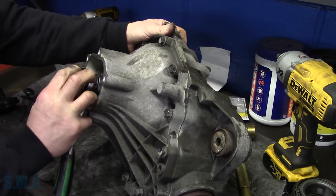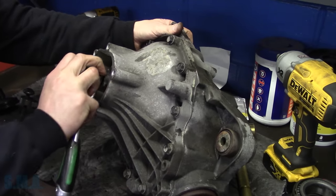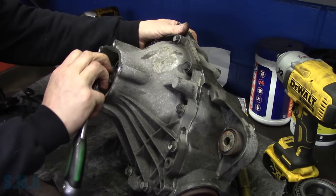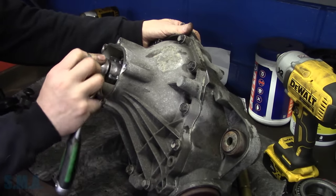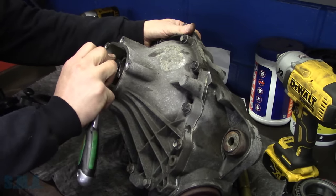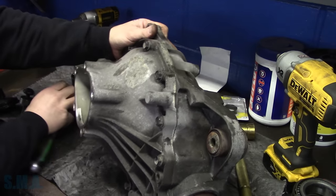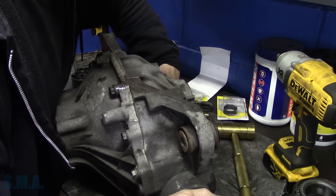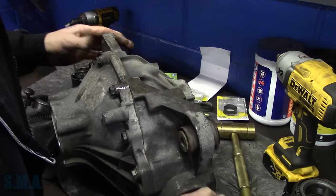We're gonna start pushing the ring gear over, start getting rid of some side play here with our fancy homemade tool. But we don't wanna go too far. Reach down in the hole here. Oh, she feels almost perfect.